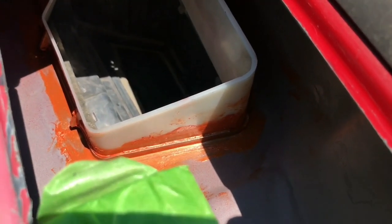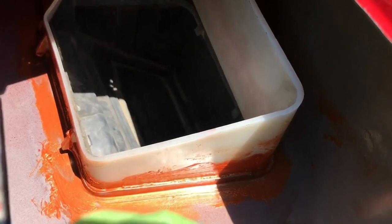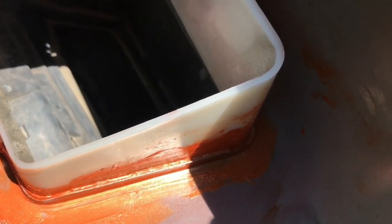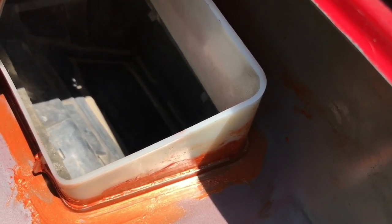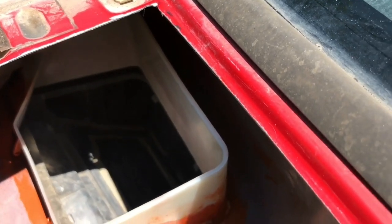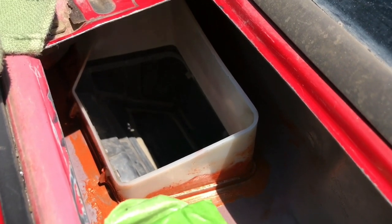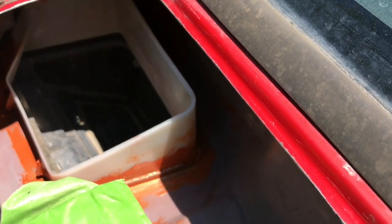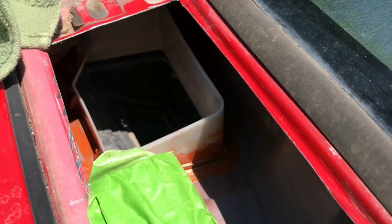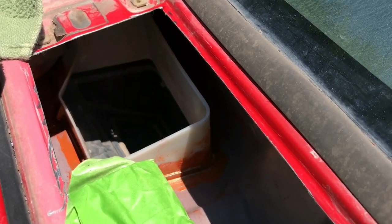I just took a few camera angles of the silicone in the back there and it looks like I got everything. What you need to silicone is in between the plastic and that lip right there - if you go below the lip, you're actually not doing anything. That lip was manufactured with part of the pressing of the sheet metal. So you need to get in between the plastic part and the sheet metal, force silicone down in there, and that's exactly what I did all the way around, using the tip of my finger. I'm going to give this a few hours to dry until tonight, and then take a hose and put water down here all around just to see if I can see any drips before putting everything back together.